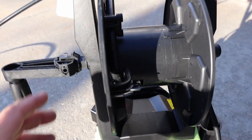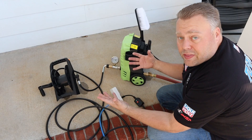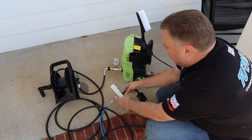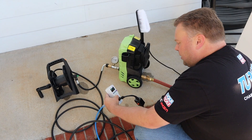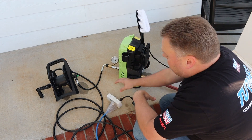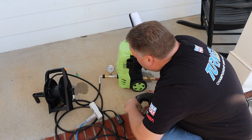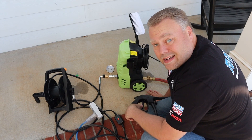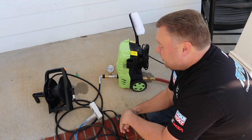The hose still wants to curl up, and just looking at the reel and how it's built, you can't put another hose on this. We have our kilowatt unit here measuring amperage. It's like 9.85 — a very safe zone for most 15-amp circuits you'll see in houses. This is out of the box with the 40-degree nozzle. We're reading about 900 PSI out of the box. So with what you're given in the box, you cannot achieve any of the numbers they advertise — not even close. That's a third of what they claimed.